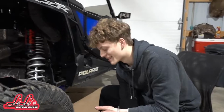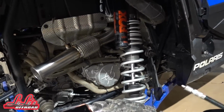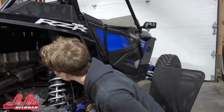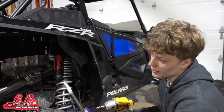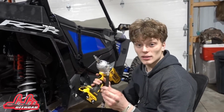Dude, say what's up. This is Sean. What up? Dude, tell them about that one bolt on the inner bend of that pipe. So, it's the left top one, right? Yeah, it's on the inside of the bend. The left top has about maybe a half an inch of leeway on each side. So this handy dandy tool works in there. You got to kind of hold the drill upside down. We used that small compact one first, but it gets her done. Make sure you got a flexible bit driver. I told you guys before, I use that flexible bit driver when we do our side case. If we have a belt blowout or something like that, it also comes in handy again. So dude, go get one of those, put it in your pack, keep it with you.